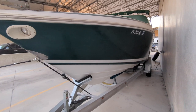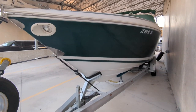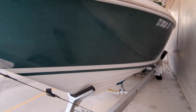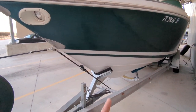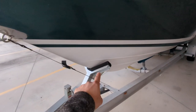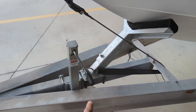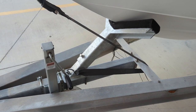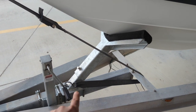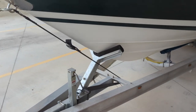Moving the boat back will shift a little more weight toward the rear behind the rear axles and less weight forward of the axles. The easiest way to do that: put the boat in the water, get it off the trailer. On this trailer, I have an adjustable bow catcher held on by some U-bolts. I would undo those U-bolts in the parking lot at the boat ramp, move it back about 6 inches, then reload the boat and weigh it again.